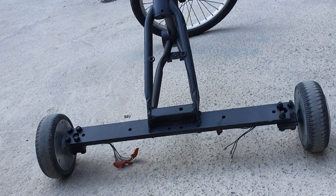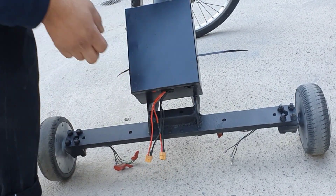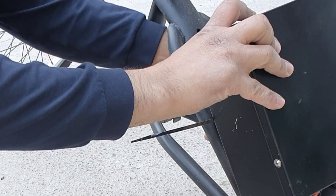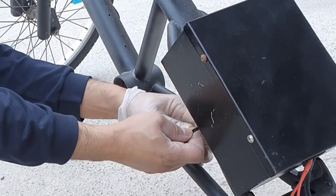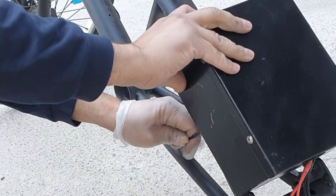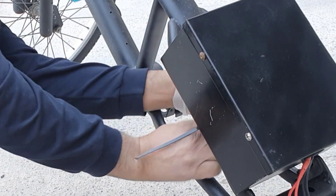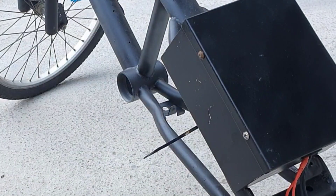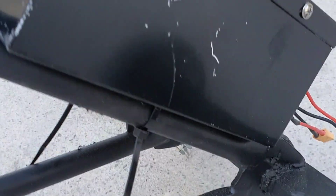With the paint job complete, it was time to mount the battery box and I must admit they do look nice in matte black. Initially I chose to mount the battery box using zip ties. In hindsight this was an error on my part, because the trike uses hoverboard motors and a BMX bike frame, there is zero suspension. The cable ties made of plastic rubbed against the metal and they did not last very long. However, I do go on to address this issue later in the video.